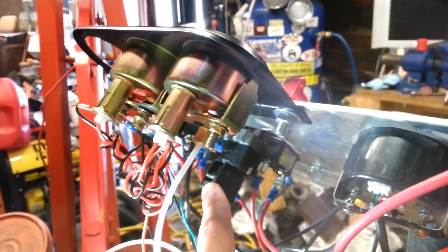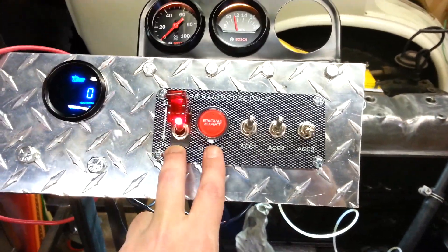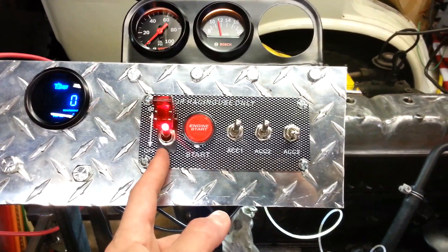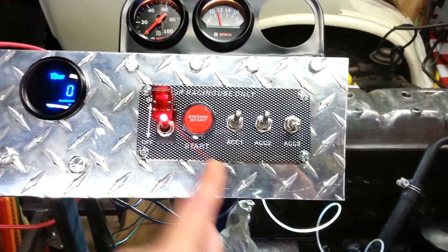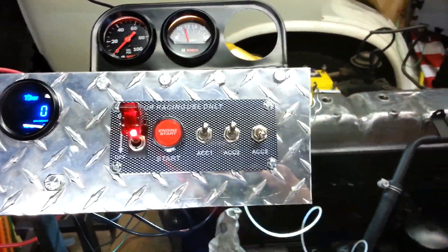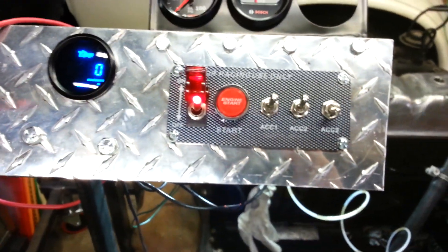You're not going to be able to see it, but it says 30 amps on this switch — that's the rating. And this part says 12 volt. This part, if you unscrew this screw on the top, says 240 — I think in China they married an AC part to a DC part, but it works. So coming back around — you have two grounds. Everything else is positive on this. If you're wiring this up to bypass your keyed ignition: 30 amps into the bottom of the master switch, out of the top you connect it to the bottom terminals on all these switches. Your loads come out the top, so when you turn them on you're energizing whatever you want — coil, fans, fog lights, you know, whatever you want.